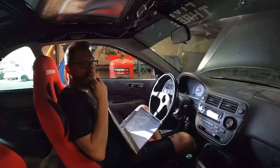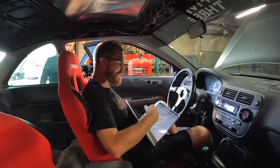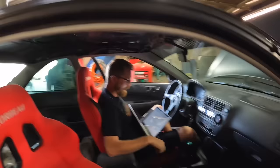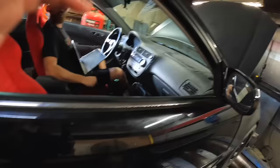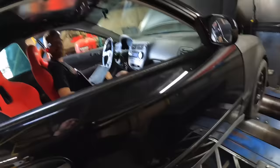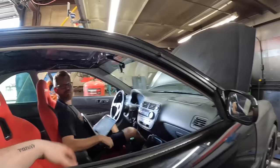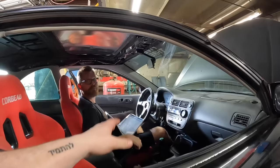The injectors are at 97% right there — that's after hardwiring the fuel pump. I didn't take any duty cycle away. I was hoping that when I hardwired the fuel pump I would then be able to remove some duty cycle from the injectors, but that does not appear to be what happened. So at 400 wheel, we're basically maxing out the fuel system right now. The 400 wheel is a lot and it's very hard to do in a D-series. Anybody that says otherwise is wrong. So this is the highest horsepower D-series you've had on this dyno? Yes, right now.